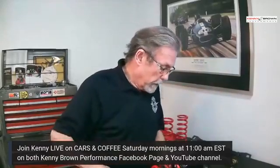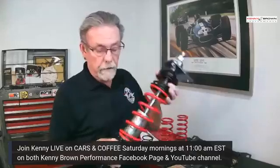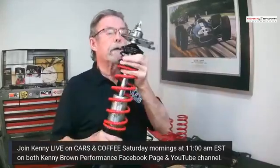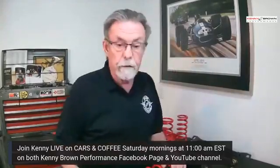Now, a long time ago when I was doing formula cars, anytime we jacked the car up and did work on it, and set it down on the ground, we'd walk around and hit every shock until it went bong. And if you hit it a couple of times and it didn't go bong, you just wait. The driver goes off, first bump he hits, then it'll go bong. That's the spring just dropping into the seat. Well, by doing the helper spring, that doesn't happen. It stays in place. Now, and this is our Caster Plus. I keep telling you guys, when you're doing alignment, get as much caster in the car as you can.